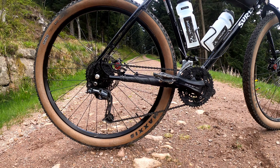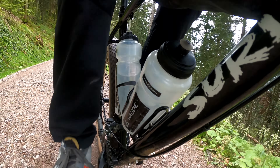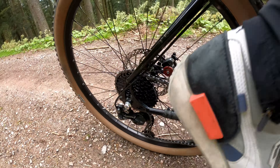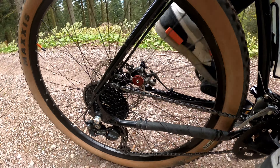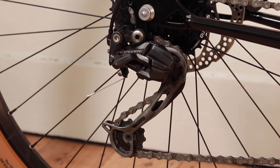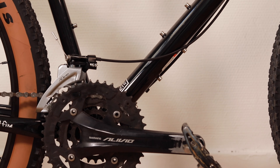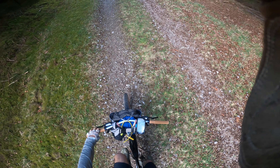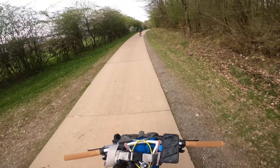For the brakes, the Avid BB7 work really well — they feel powerful, they have enough modulation, and I find they are easy to adjust, easy to install, and low-tech. I love them. The drivetrain is working perfectly, and for the front derailleur which is not exactly what Surly recommends, it works perfectly. The only issue from using a normal front derailleur is the reduction in tire clearance — with this configuration I'm getting somewhere between 2.2 and 2.3 inches max. The gear range is certainly enough for my type of riding. I'm used to Shimano and this mix between Shimano Deore and Shimano Alivio works fine, although in the future I might upgrade everything to Shimano Deore for a more coherent drivetrain. For the moment it works just fine. I'm really happy with my build, very happy with the geometry of the bike and the simplicity of the frame specs and components. I think it's the perfect compromise for riding off-road and also being able to cover long distances on tarmac. I hope this video was useful for you — like and subscribe if you wish, and see you next time.